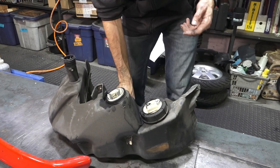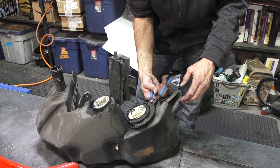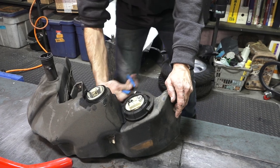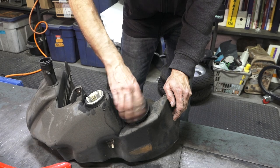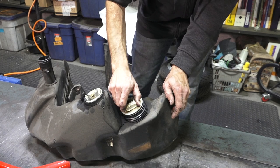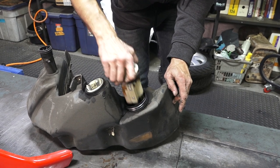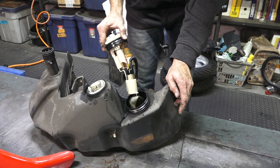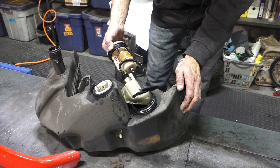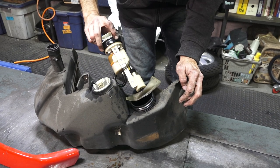Removing the fuel pump is a little more difficult — they've got a ring. You can use a strap wrench or even a big pipe wrench, but be careful — this is a plastic nut. I have an oil filter tool that works very well for this job. Remove this ring and then lift the pump out, walking it out carefully. This pump is likely original — no issues with it — so I'm going to put it back in. They're usually pretty robust.